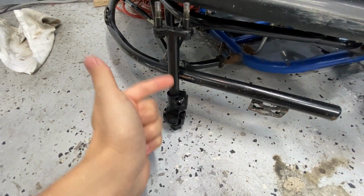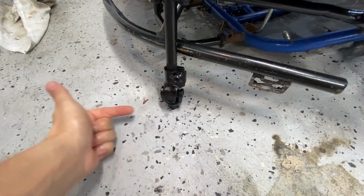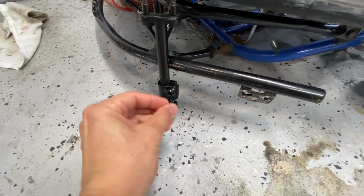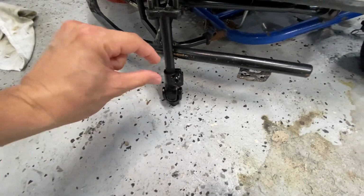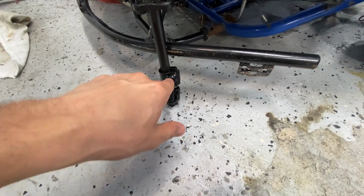There's a flat spot on this shaft here, and in the steering rack there's a hollowed out section that the bolt goes through to bite everything closed. That little 1/4 inch difference means the bolt won't go through that zone on the flat shaft here.